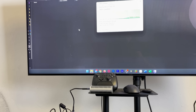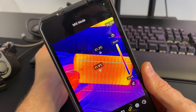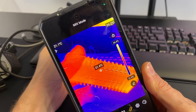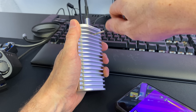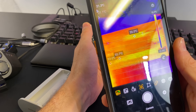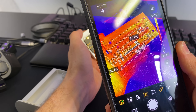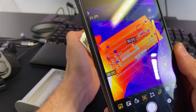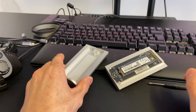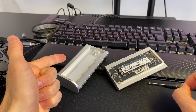The read speed is even more insane, and after over 200 GB transferred it still looks really nice. Opening it up to check the NVMe temperature — the thermal pad was on it really nicely — and the NVMe has exactly the same temperature as the housing, meaning heat transfer is optimal. You'll always get full speed with no thermal throttling. These huge grids are definitely not overkill. Massive thumbs up — this enclosure is great.